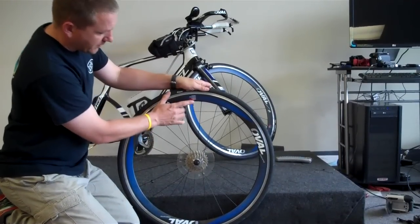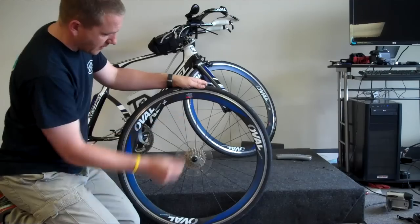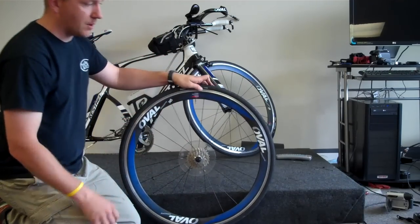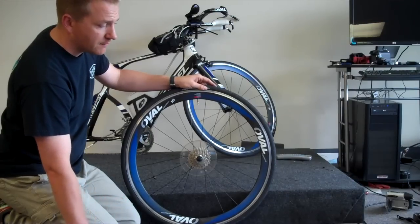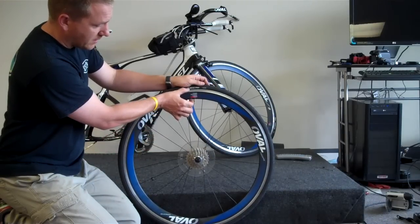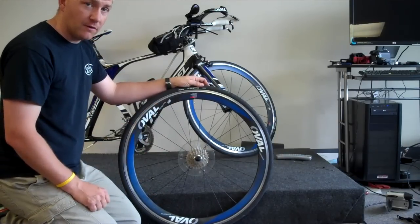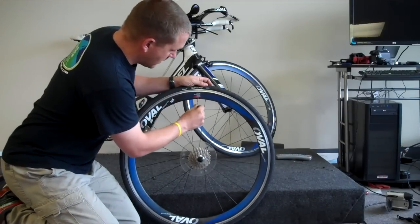Okay, the first most important thing is if you have a little collar that's here on your valve, you're going to want to take that little collar off. Otherwise, you're never going to be able to take your tube out of the bike. Now, it's very important. We're showing you here 3 different valve lengths. There are 32 millimeter valve lengths, which is the shortest, the 48 millimeter, which is the middle, and then the 60. It's very important if you have dishing in your wheel like this, which is a much wider valve, that you know and that you ask your local bike shop for the appropriate size valve. If you have a much deeper one, sometimes you have to get an actual extension that you can attach.